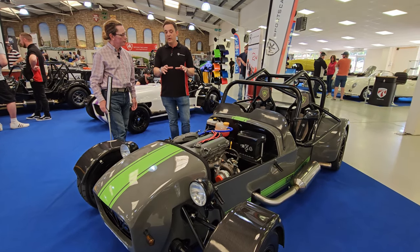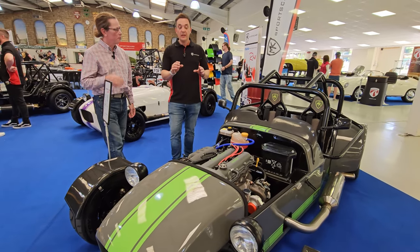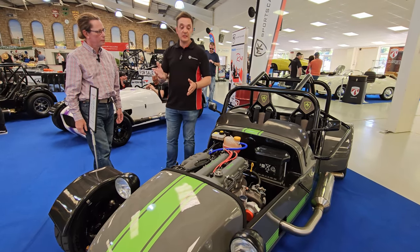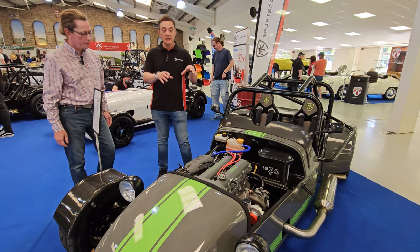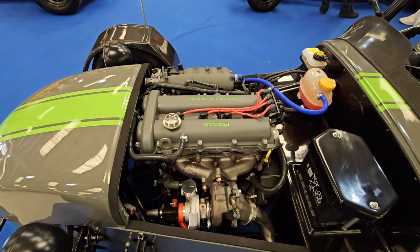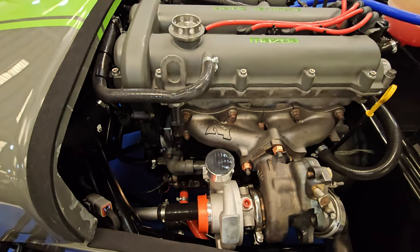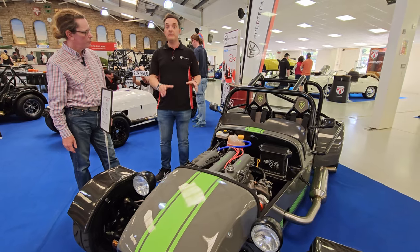If you're looking at the Mazda car and thinking it's a standard 140 horsepower, there is an upgrade path available later — forced induction. This is showcasing the 250 car. We do a bolt-on turbo upgrade: it's an ECU, the turbo, the exhaust system, and everything exits through the same hole in the side. It's literally a weekend's job to do the upgrade and get 250 horsepower.